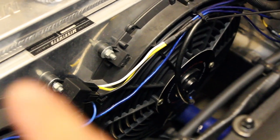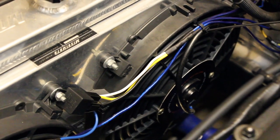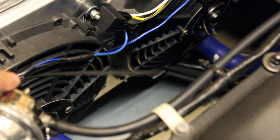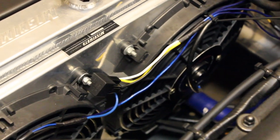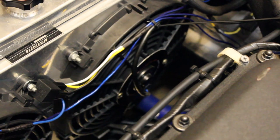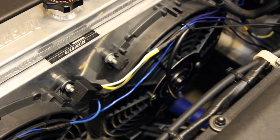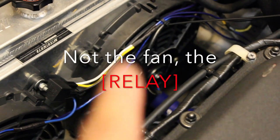So I'm going to show you what I did. There's a relay right there. Prong 30 on the relay is connected to the positive wire coming off of the e-fan. Prong 85 and 87 — you can clearly see there's a yellow and a white wire — I bridged those two wires together and ran one wire, tapping that into my inline fuse right over there. That's the power source connected to battery, and that is a 10-amp inline fuse. Lastly, prong 86 off the relay is ground — I connected that to the ground wire that's connected to that fan.